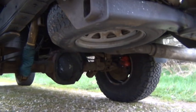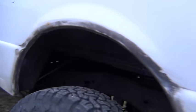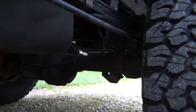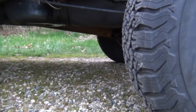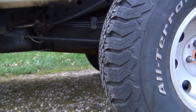Spare tire carrier — a new one of those. Underneath the springs I'm running four-degree shims to correct my pinion angle, so the pinion is slightly down static and then under load it rises a couple of degrees. That was pretty big — it was pretty awful before.